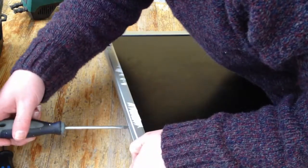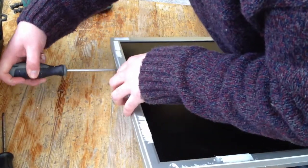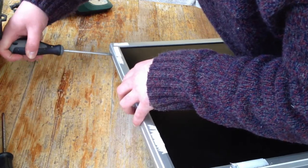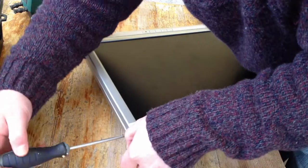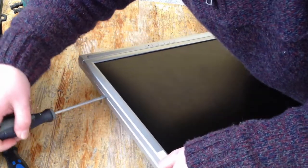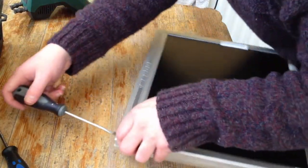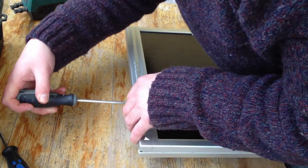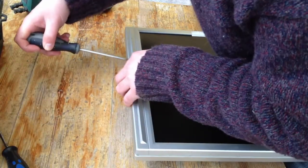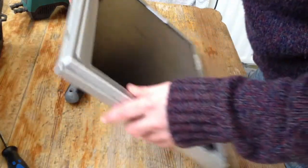Once we have it in this position, I just get a plain screwdriver and jam it down between the bezel — the plastic front and back that clips together. Now you want to be careful. Some people use plastic spudgers, but I find them flimsy. Using a screwdriver will leave small marks, but most people really don't care. Given that these monitors are worth so little these days, I just go at it with a plain screwdriver until you get it off.